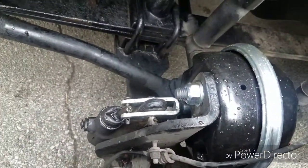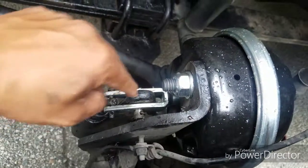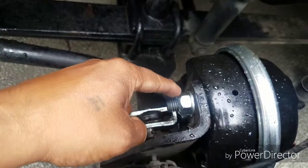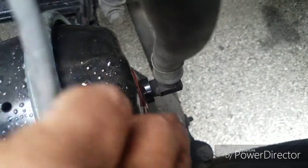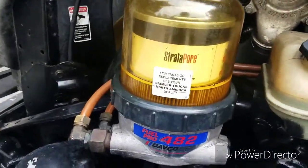It's very simple — like I said, you take these two pins out and then the slack adjuster is going to be moving. Then you take these two out with the 15/16, and then you take that line out. You also have to take this line out because the chamber just comes with this — it doesn't come with the fitting or the hose. It costs about 56 dollars. That's what it cost me. And here's a tip: if you break down and you have a Freightliner...